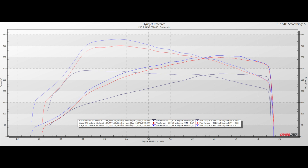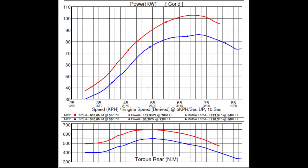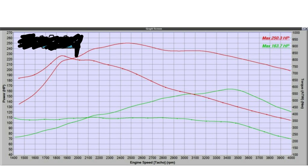The N55 with the pneumatic wastegate (PWG) is really only capable of about 360–370 horsepower with full bolt-ons and a tune, whereas the electronic wastegate can reach about 410–420 — depending on the tuner, fuel, location, and dyno used. On dyno manipulation: an easy way to spot it is that the power and torque curves on the graph should intersect — creating an 'X' — at exactly 5,252 RPM, indicating an accurate correction factor. A crossover at 4,500 or 6,000 RPM suggests manipulation. A common trick is overlaying stock and tuned curves using different correction factors on each.